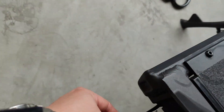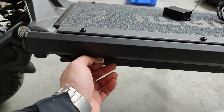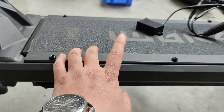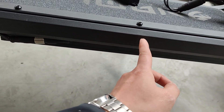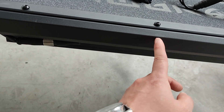On the other side, there are only brake cables. In case you have to exchange the rear controller, you will have to unscrew all the bolts here and lift up the battery from the frame so you have access to the cables. The cables are fixed to the frame by the cable holders.